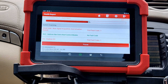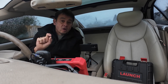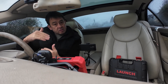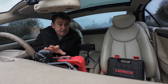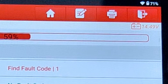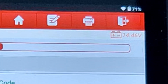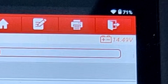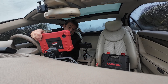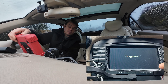Just a couple of things whilst we're running through - you're going to probably hear different modules come on. You might hear the ABS brakes start to work, you might see diagnostic come up on your command screen, or you might find that the air from your vent starts to blow. That's as it's going through the different control units doing a little handshake test. On the bottom here it tells me the car and my chassis number. On the top right-hand side it's giving me a voltage - 14.49 volts. I've got the engine on so obviously the alternator is charging. And look at the screen - diagnosis is coming on because it's now in the module for the command unit.